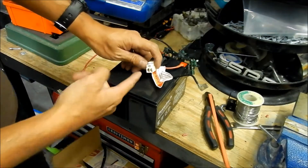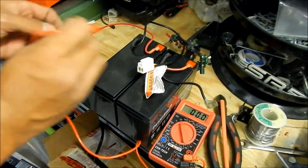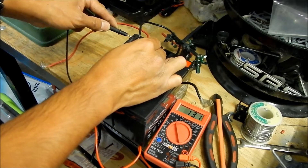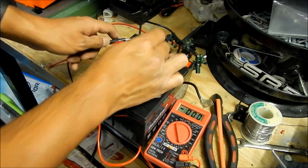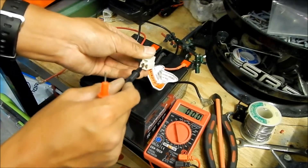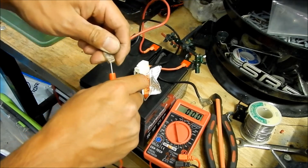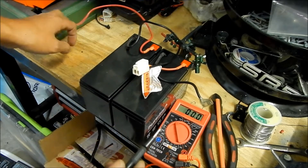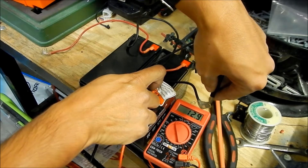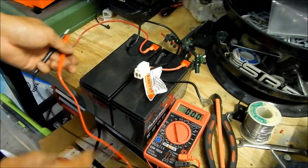You could probably get a voltmeter and check the voltages — you actually probably should do that. I'll check each one and then check the whole system. Right here we got 13.1 volts. This one — let me just plug this in here. Okay, 13.1 volts for the left battery. And the right battery — it doesn't really matter which way you put the probes in; it'll just show negative voltage if you get it wrong. This one's 13 volts — a little lower because one of them was in the charger before this.